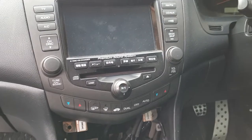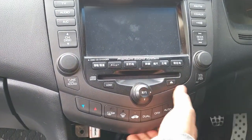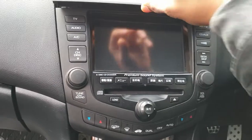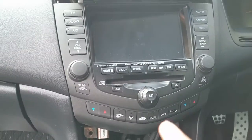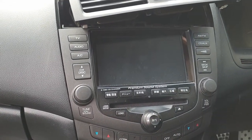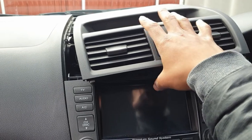At this point you should be able to put your plastic removal tool in there and clip off this whole center console. This one comes off here, this one comes off here. I mean I could have taken that off directly at the top, but we're getting to the head unit and checking all the wiring at the back. Now this one's out of the way and we'll take this to a bench and have a look and see what's wrong with that top.